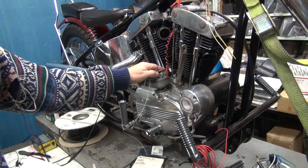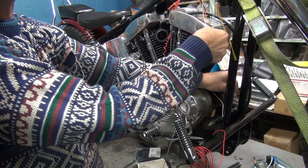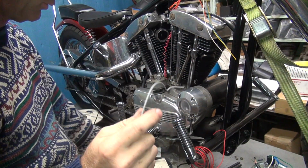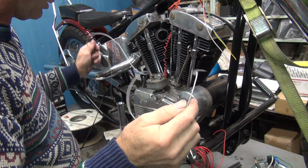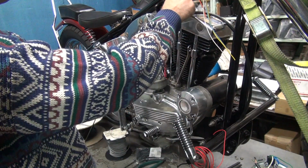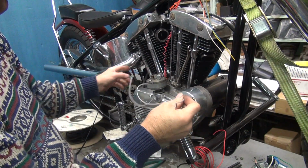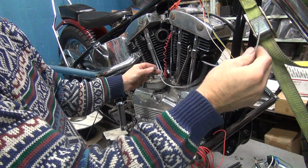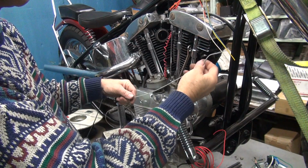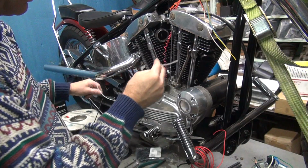So that's going to come off our distributor right here, and that's going to go across the generator and then poke up and go back up here all the way around to the coil way on the other side. Now, you got to feed the wire from one of two directions, either from the distributor side all around to our coil, or come back around the other way. So, I'm going to leave it off the distributor side, so I can always pull more wire up in the harness if I need it to get all the way to the coil. Or if I got too much, I can pull it back. I don't like running an extra couple feet out of the end and cut it all off. It's just a waste of wire. So we're going to go ahead and do that.